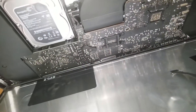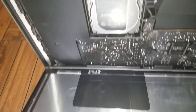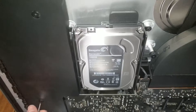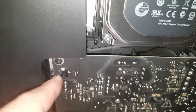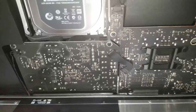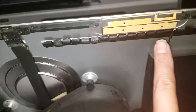With the screen disconnected, you don't want to lean it all the way down because the adhesive can tear off. I like to leave that adhesive there so it's easy to put back. Once you do that, you'll want to remove the two screws for the speaker and move it aside a little bit — don't take it out completely or you might accidentally pull the power button cable out. Inside you'll see the power supply, motherboard, the other speaker, a fan, and the antennas.